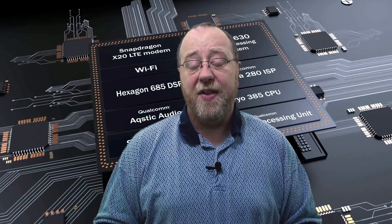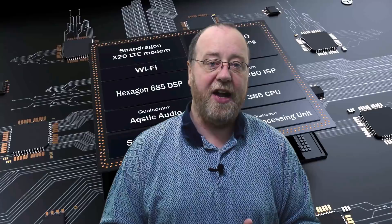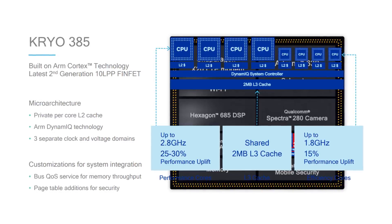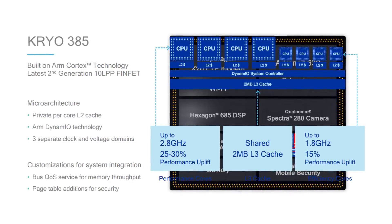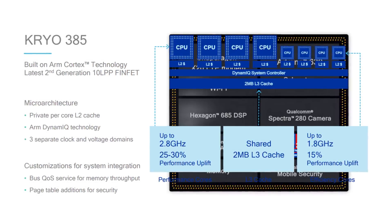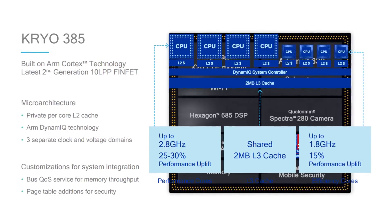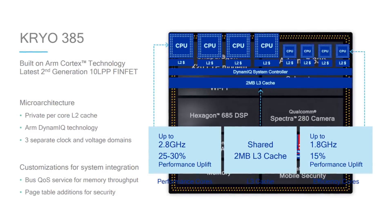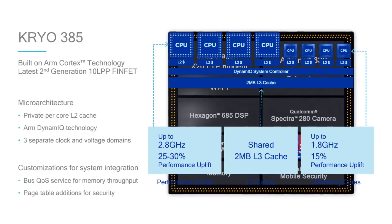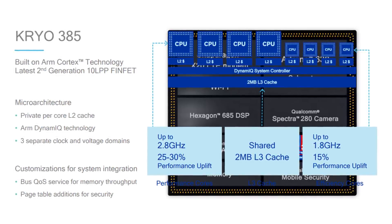It's probably based on the Cortex A75 and the Cortex A55. The A75 and A55 are the two new core designs from ARM that use DynamIQ. The great thing about DynamIQ is that these cores are now together in the same cluster, which means they can share a lot of the same buses and input/outputs to the rest of the chip without having to be separate and working independently.